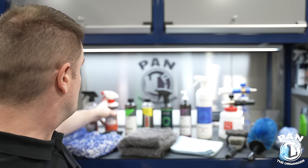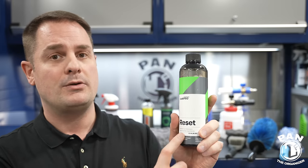Always wash your car in the shade on a cool surface, never in direct sunlight — that's to avoid water spotting and products drying up on you. After spraying the bug remover, you blanket the vehicle with a snow foam, which encapsulates and emulsifies loose dirt and debris. You rinse that off to minimize the chances of scratching or marring your paint during the contact wash. We're going to use a soap that works both in the foam cannon at a 1:10 dilution and in the bucket for contact wash at 1.35 oz in a 4-5 gallon bucket.